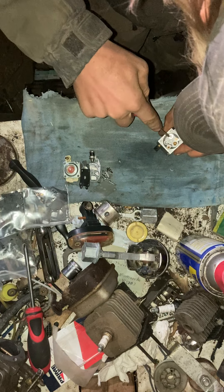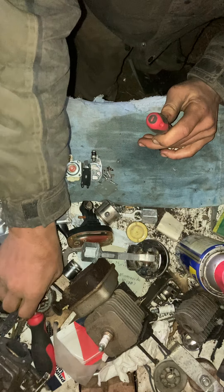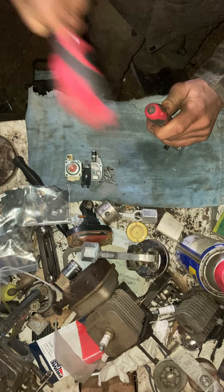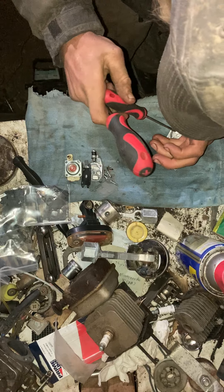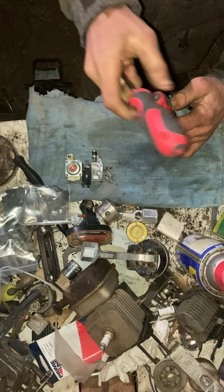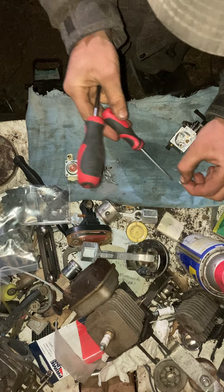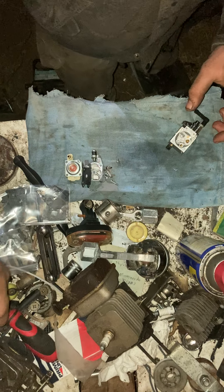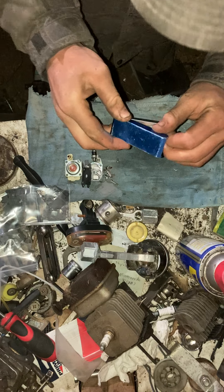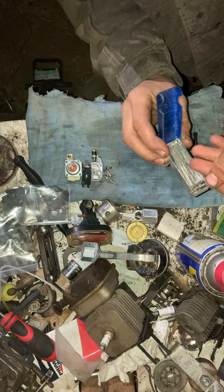I've watched videos on how to do this a while back and I've done about 20 or 30 rebuilds since then. There we go — just punch a hole and pry it out, that's all we do. Now that's junk, just throw it away. Then we get a 40-tip cleaner and file kit and select our smaller file.